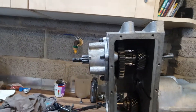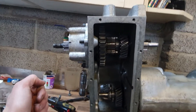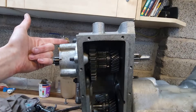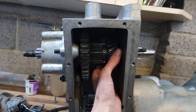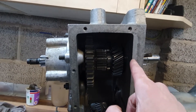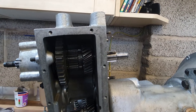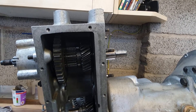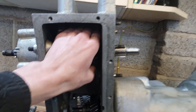Hopefully it'll work. Just as I nipped the nut up - not very tight but the last little bit of travel, pulling the nut down the stud - it tightened up, so it was free right up until that point. The preload on the bearings is shoving this bearing too tightly that way and it's pushing hard against that circlip and it must be deforming it.